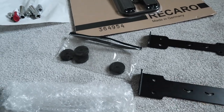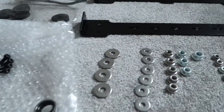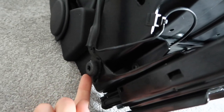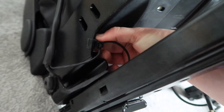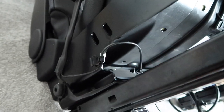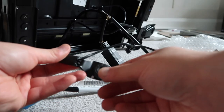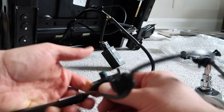I've got all the hardware for this side laid out from JCR and worked out the sizes of bits I'll need. First, for a quick and easy win, I can remove the seat belt buckle — this requires the same T50 Torx used earlier. I need to make sure this cable is clipped off the existing seat base so the wire is totally free, then remove it and transplant it onto the new JCR frame. We actually need to keep screwing while applying some downward pressure to get this out.